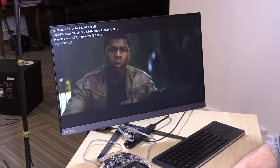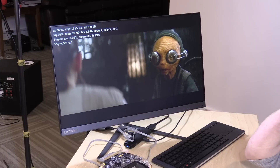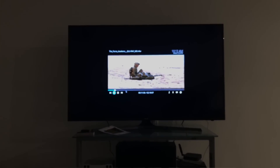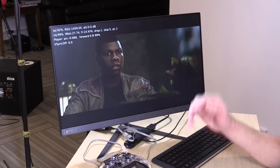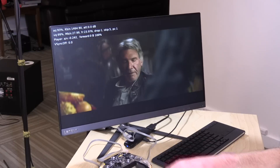I'm also not going to recommend this as a home theater device. It does play back movie files just fine — we're running a pretty high-bitrate Blu-ray MKV file right now and we've had only one dropped frame in the last 10 or 15 minutes, so really good performance there. But what it doesn't do is 24p playback. When I plugged it into my TV and it tried to switch the resolution, it dropped into a tiny little window and didn't look great, even after switching from 4K to 1080. It also doesn't support lossless audio formats like DTS-HD or Dolby TrueHD. If you are a home theater aficionado, 24p and those lossless audio formats are pretty important, and this just doesn't support them. For basic movie playback on a monitor it's fine, but I would not consider this a home theater box at all.